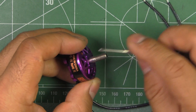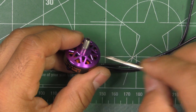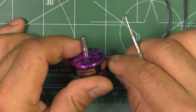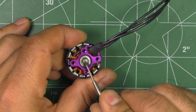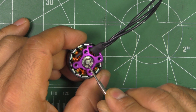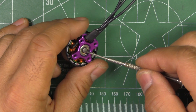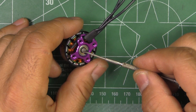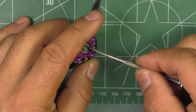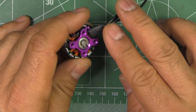Before they would be hollow all the way through, but this partial hollow doesn't save that much weight, and since it's in the center of the motor it doesn't affect rotating mass. It's probably not even a gram of savings. At the bottom of the shaft, they're no longer using retaining screws — they're using circlips. Some people prefer retaining screws, but circlips are fine. They're a little harder to remove, but retaining screws have their own disadvantages: if you tighten them too much they can bind the bearings, and sometimes people strip the screw heads. Either one works.